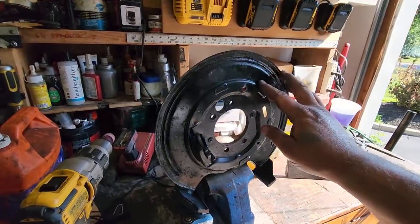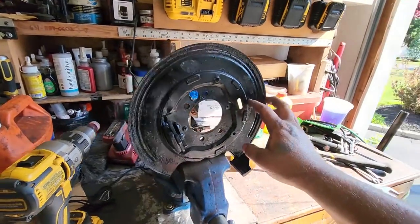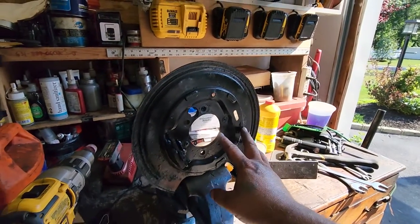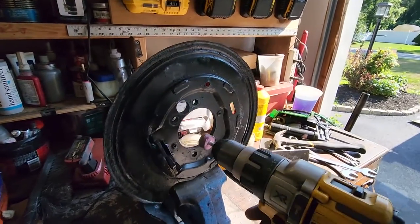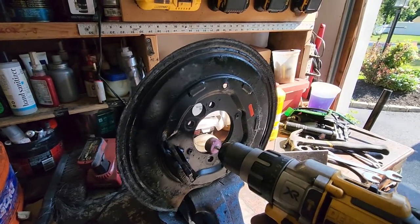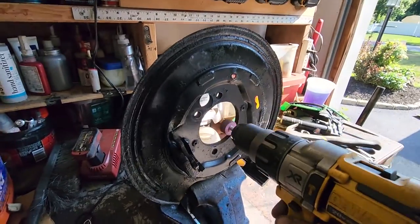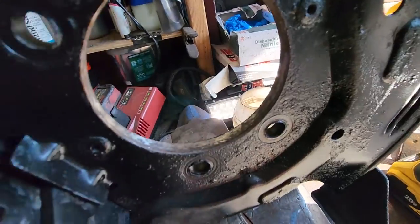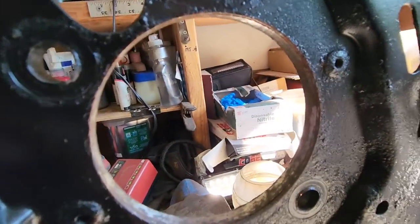All right, guys, remember this backing plate that I prepared for my Dana 35 on Black Beauty? Yeah, well, this thing is gonna be the exact same setup on the Chrysler 8 1/4. The only difference is I just gotta remount this middle ring to fit the bigger diameter Chrysler 8 1/4 axle. There we go. Open that up. Now it should slide right onto the 8 1/4.